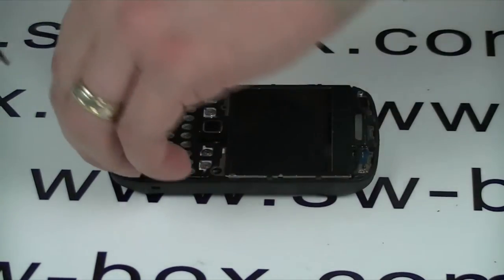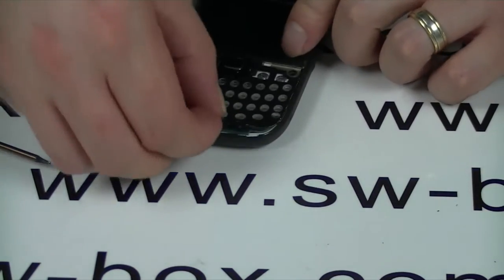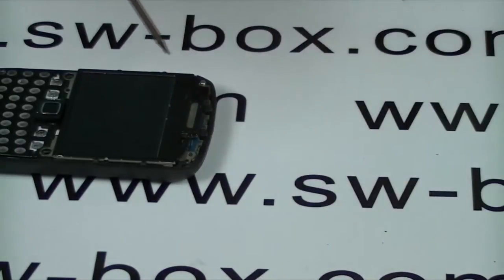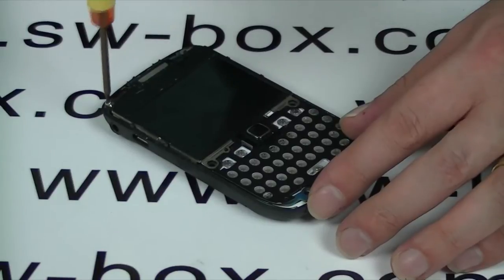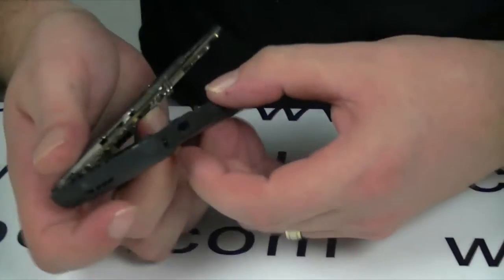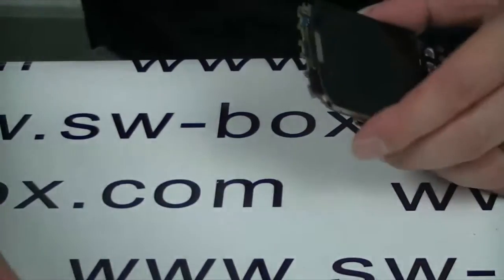As you can see it's quite simple. Now there's a little plate here so you need to remove that — just like so. Two more screws to go right on the top. Once that's done, I start here where the charging port is, and with my fingernail I just go into the side of the frame and push from the back, and just move it along until it comes out. It does get stuck so you have to wiggle it about — don't be afraid, just pop it off. There are dowels and all sorts of things holding it into place, so you won't need your frame anymore.